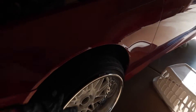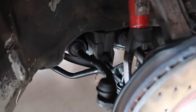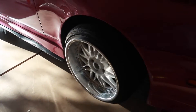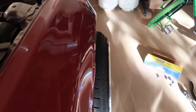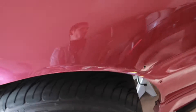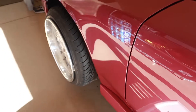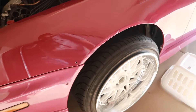That should correct it for the meantime - the alignment shop will adjust the inner tie rod to get a more accurate reading. I'm going to install both and then do my final eye adjustments. So let's knock this out, put the wheels on, and see where they sit. New outer tie rod is installed, wheels are both on - steering wheel is straight. We are toeing outward about one degree or so, so we'll push out one revolution. That should get it near straight. On the driver's side it's actually pretty good. The steering wheel is straight - it's about straight, it's slightly toed in.